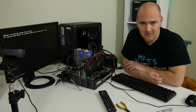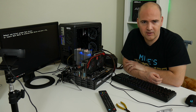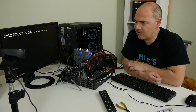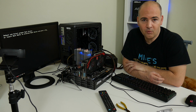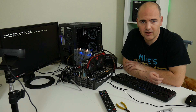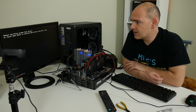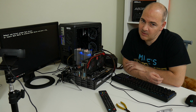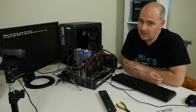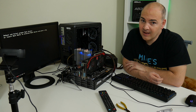Right, so that's the BIOS update completed. It's rebooted twice to update the settings, and now we're left with a boot media error, which is fine because there are no hard drives or SSDs attached, so it's not likely to boot into anything. So now all we need to do is remove the CPU, swap it back for the APU, and see if we can get it to boot.